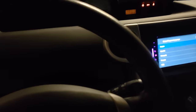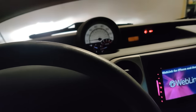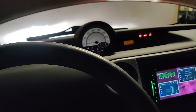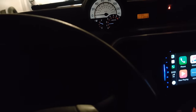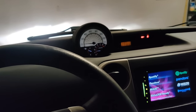Seems pretty good to me. AC full blast — it's bogging down a little at like 800, 900, but it's not doing too bad. Kicked up a little bit, a little high still I think. But the check engine light went away. We'll see. I just really don't want to re-solder that, but I might. I'm gonna wait until my intake comes in — new intake filter — and then I'll see.